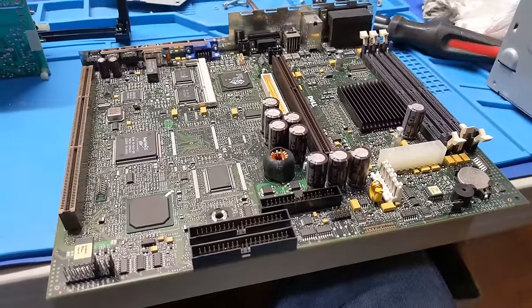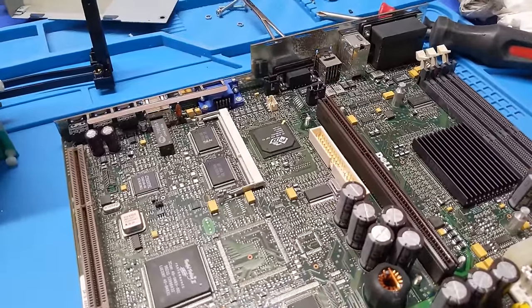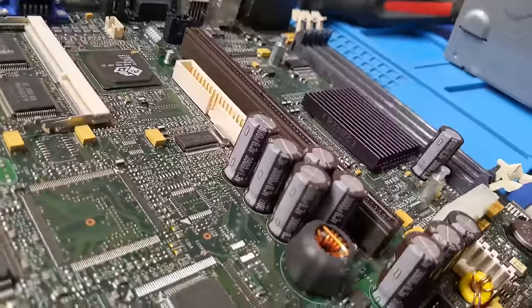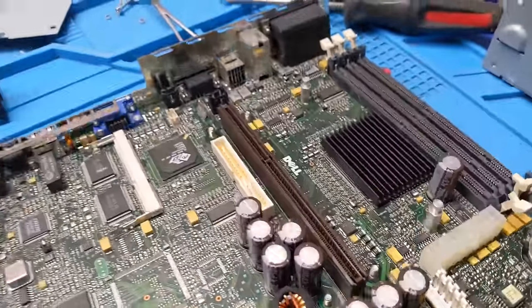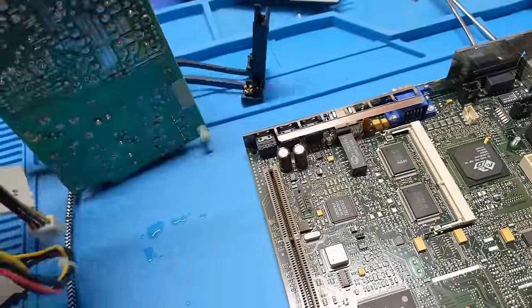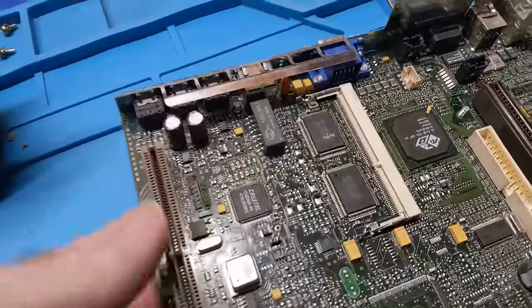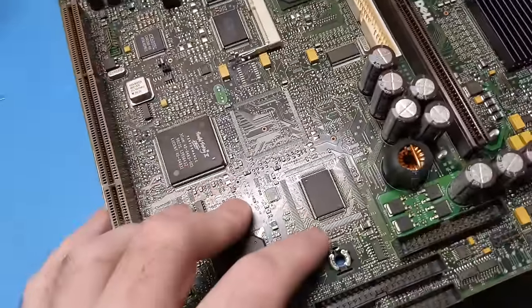Yeah, it's looking like we're going to need to get a capacitor list together because, according to badcaps.net, this series here is also on the known bad list. The PL series of Nichicon is on the known bad list. These LXFs are on the known bad list. I don't know about these here. LXF, yep, same thing. So, alright, yeah.